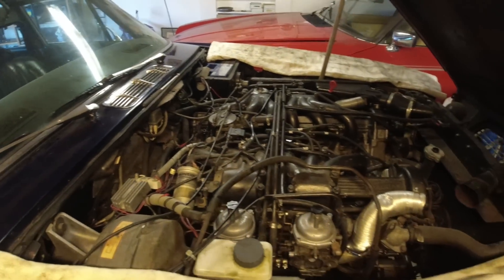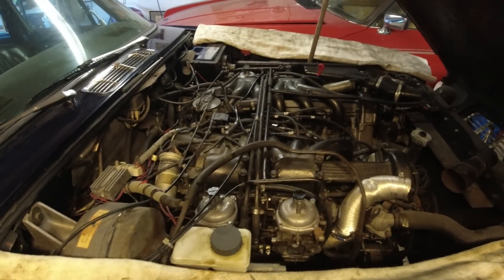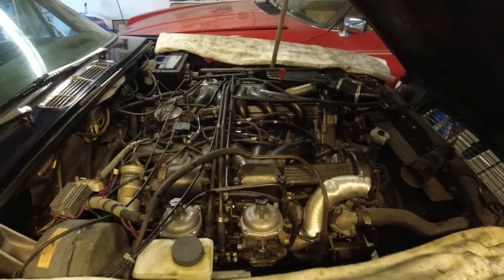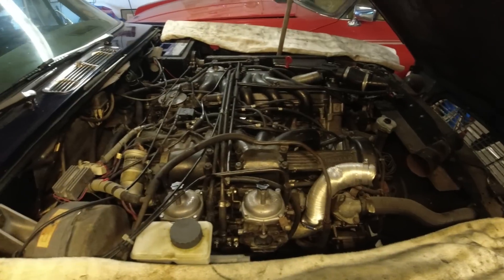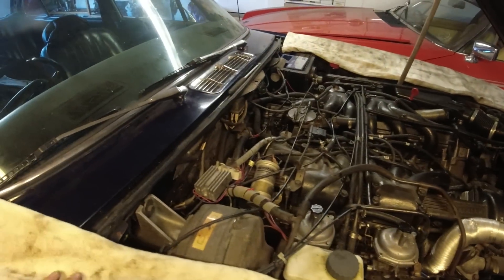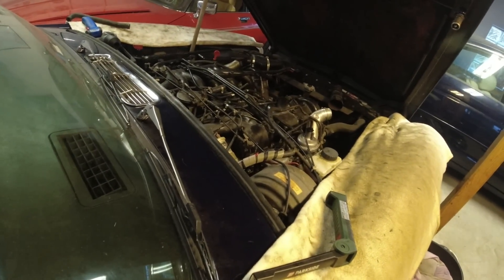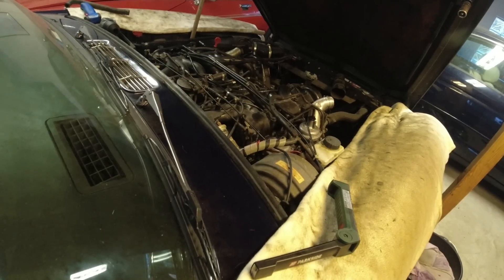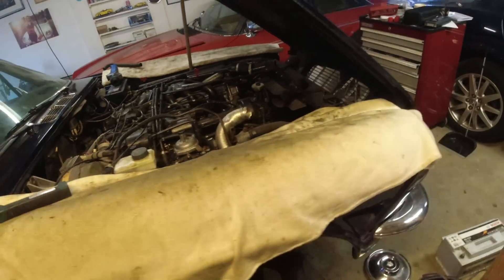Sounding very, very nice though. But I've got to wait for it to warm up, then I can go around and check the air balance and sort of check by lifting the piston to see what the mixture is like. It's pretty much warmed up now and I'm going to start and show you guys what I found, because currently it's running on three carbs.